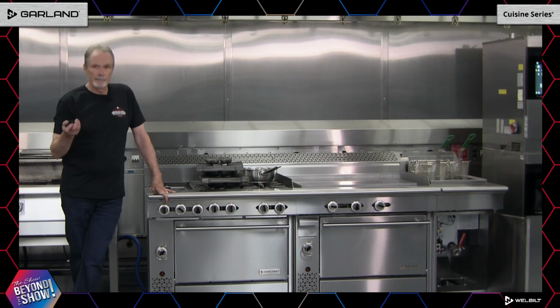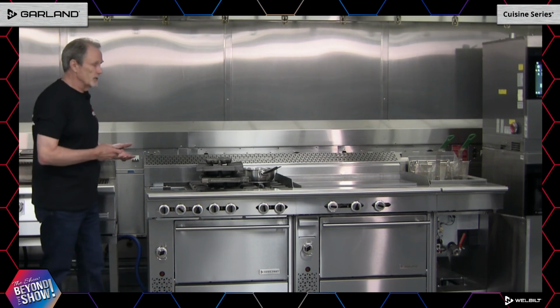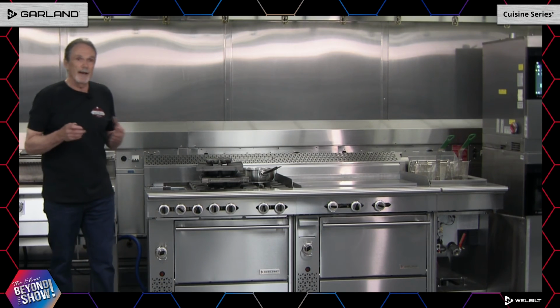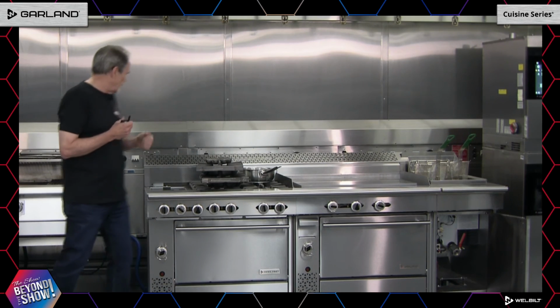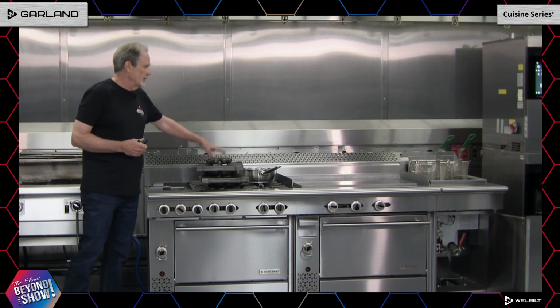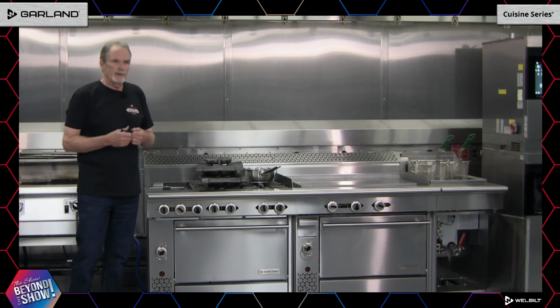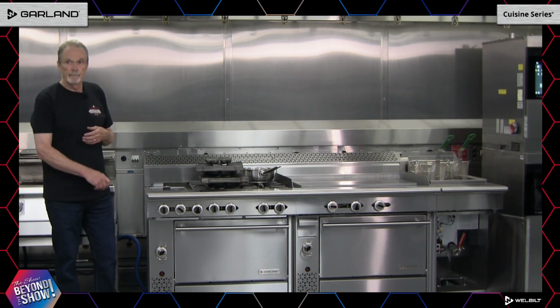Maybe you didn't hear me, the BTUs on a 36-inch unit are 30,000. We have two H-style cast iron burners. We love cast iron at Garland because cast iron is a heat sink. I spoke about that heat sink in the broiler. Well, cast iron on a burner, on any type, is a heat sink. It lasts longer. It's more durable.